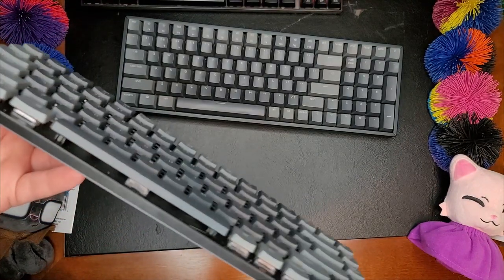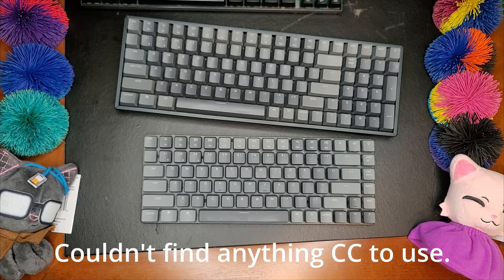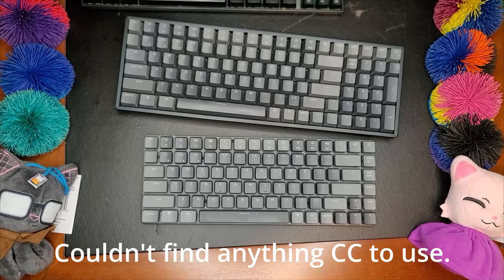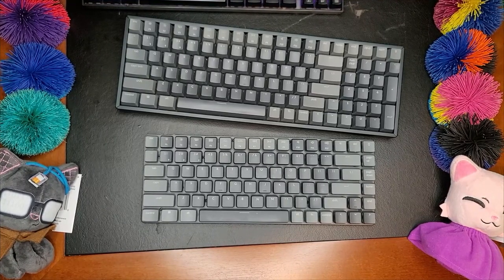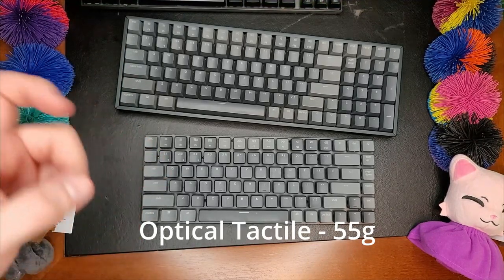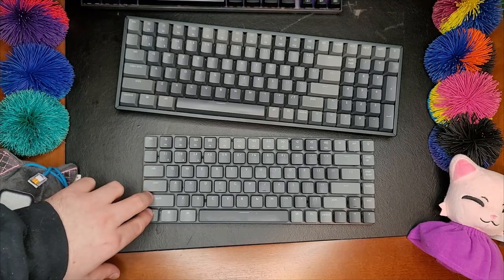But these are technically what's referred to as optomechanical. What makes a mechanical keyboard mechanical is that it has a mechanical switch — a mechanical switch is literally making a mechanical effect in order to depress the keyboard. What a traditional keyboard does is a rubber dome slash capacitive switch, where there's a little rubber dome that you depress, and it makes contact with a piece of metal, and that contact counts as the key press. This is an optical mechanical keyboard — instead of it being just mechanical, it's actually a little laser that goes through to see if there's movement. This keyboard does come in a purely mechanical form, but strangely enough, this is cheaper, and I actually prefer the feel of this compared to the mechanical one.